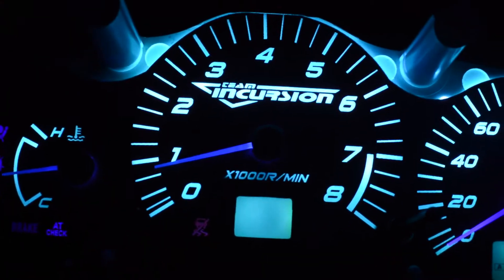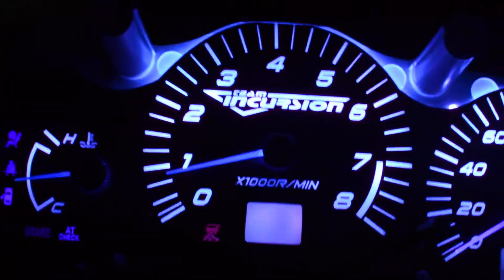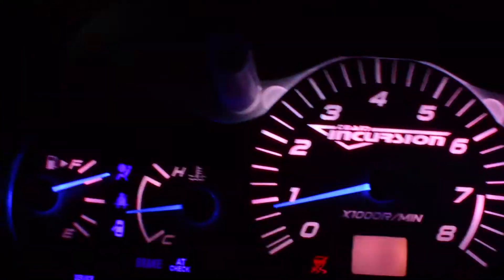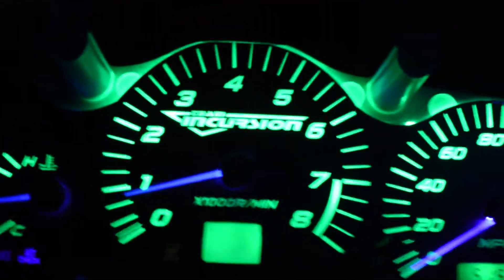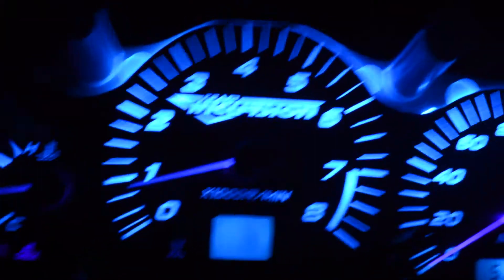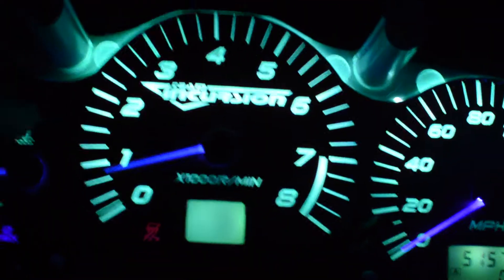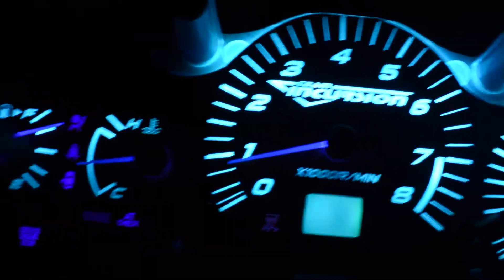Still did not work. So I got another 350Z cluster and rebuilt it. It was a 14-hour build because you have the LEDs coming in with little wires, and your LEDs are right under your needles so they're bright. And then all your hazard stuff is blue.